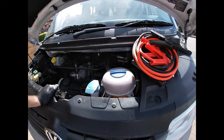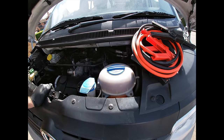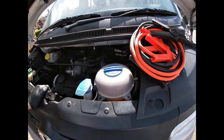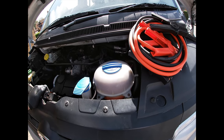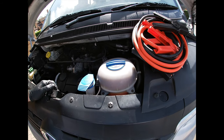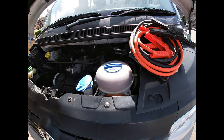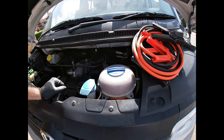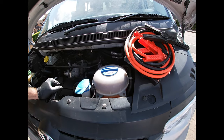So we've looked at trickle charging, which is the preferred option. The T5 is particularly vulnerable to electrical spikes which can be generated when boost-starting, so trickle charging via an extension lead is preferable to using jump leads. Alternatively, physically remove the battery, charge it up and bring it back, or fit a new battery.